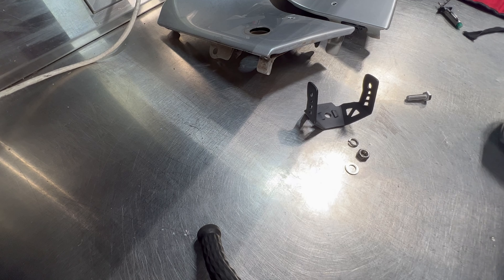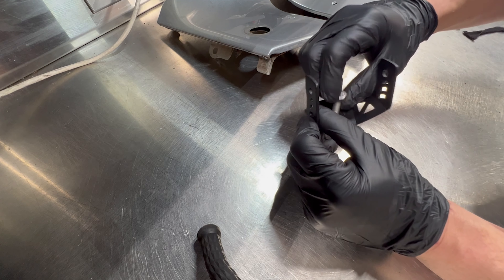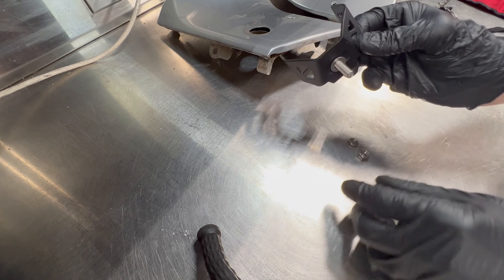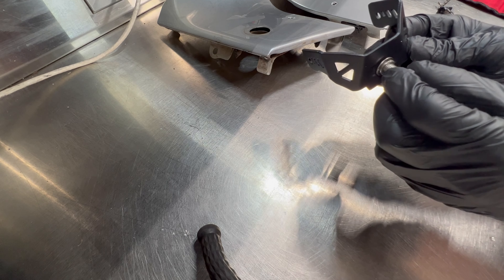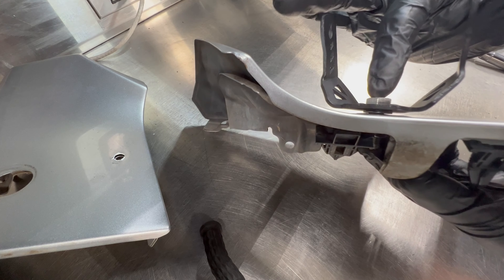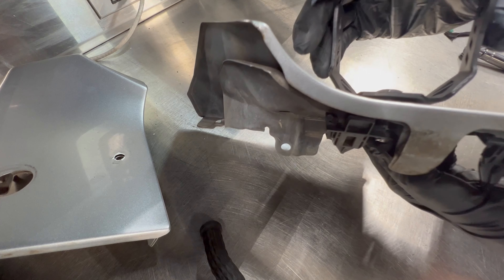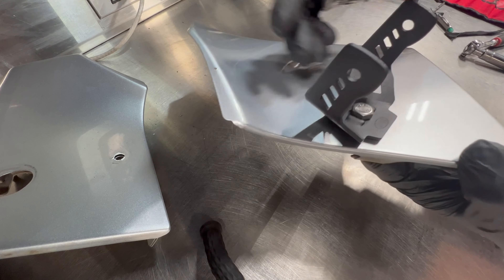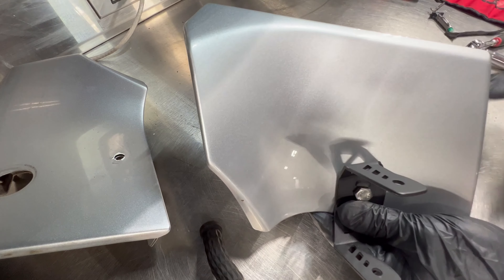While waiting for that to dry I noticed something about these brackets I like — they've got raised little notches so the bolt sits down nicely, which helps prevent it from turning when you're tightening from the back. I'm going to go: bolt, washer, body panel, locking washer on the bottom, followed by the nut. Now that the paint is set up, just as I said — bolt, mounting bracket, washer, locking washer, and nut. Make sure this is pointed towards the front of the vehicle and the edge is parallel to the edge of the truck so they're nice and straight.